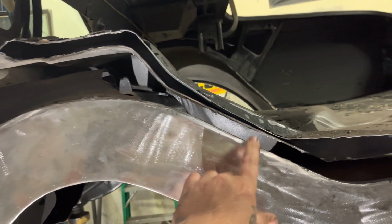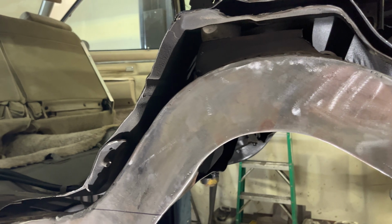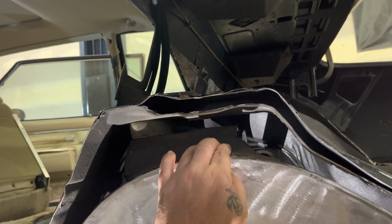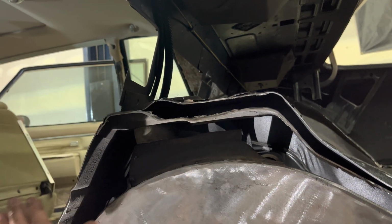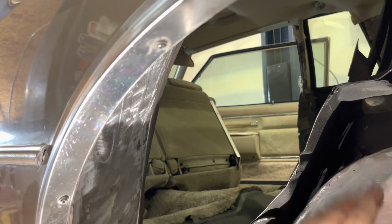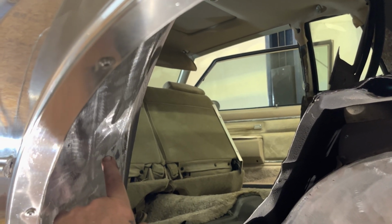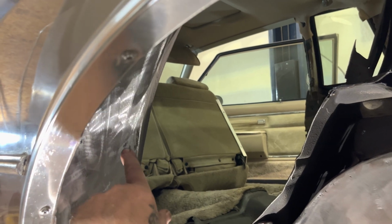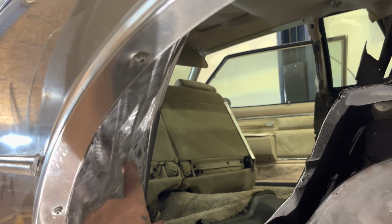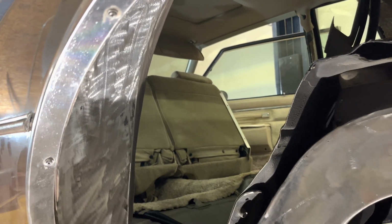So once you tap, tap, tap, then you could take this back out and cut that off. That way now that piece is out of the way, and this tub area right here will move in. And then you'll be able to set exactly where you want. Then if you got to take the screw back out to reposition it, you can take the screw out and reposition it. When you're done, you'll have screw holes, whatever. You take the screw holes out, then it's called plug welding because you have a hole in this side, hole in this side. But if the hole doesn't line up, now you got a hole in the tub side and the hole in the outer tub side, two different locations, you can plug weld, plug weld, plug weld, and then you end up making it fit better.